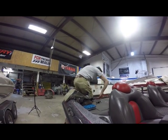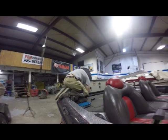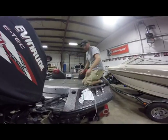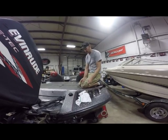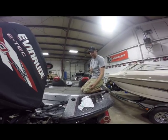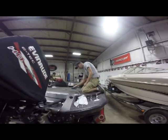So, done with the fish tape, throw that out of our way. Now we're going to bring our wiring straight up through the bottom receptacle here on the back side. And now I can close that. As you can see, we also did the color coordinating to try to match up with what the lights are already. The receptacle, for example, has a black and white wire. If you notice, the wiring that comes off all our rear anchor lights for the shallow water anchors is also black and white. Ground is black, white is power. So we're going to cut these and splice on two connectors here.